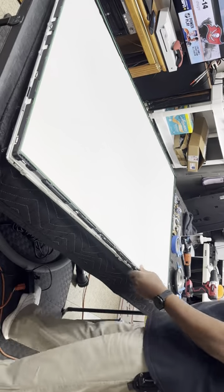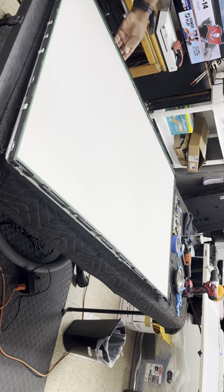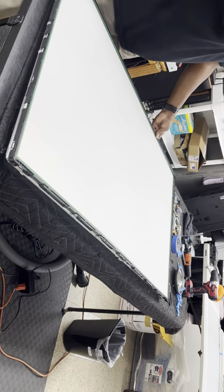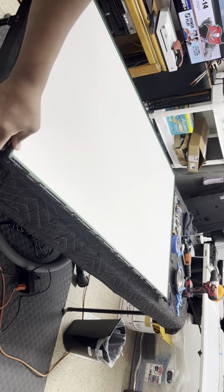You gotta make sure they snap on even too, because they're uneven. You're gonna try to put TV together, TV ain't gonna squeeze together right, and you'll actually crack the screen. So after I snap them in place, I go all the way around and make sure all of them are literally snapped on. And not partially snapped on.